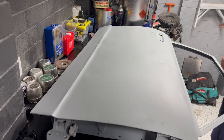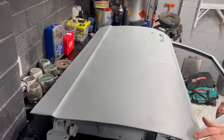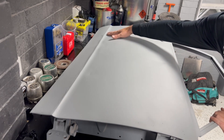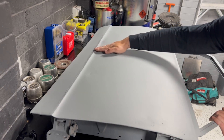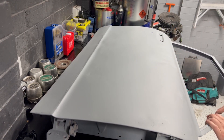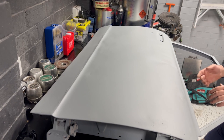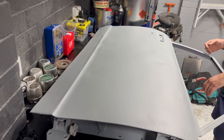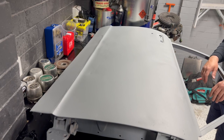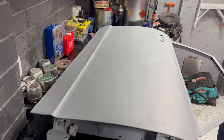I've turned the strip lights off just so the damage is a bit more obvious. You can see we've got a couple of decent dents through here — there's actually a couple of spots where it looks like welds have been put over, not the best. As you look through there's a big dip and I can see some metal has been welded in there. For me, getting this perfectly straight is an impossibility with my skill set, so I'm just going to get in there with a hammer and dolly, do what I know to get it as good as I can. We'll get some filler over the top — unless someone has a set of straight doors for a KE25, I'm going to have to make the best of this.